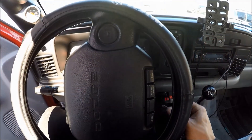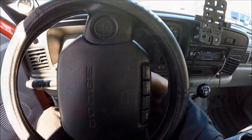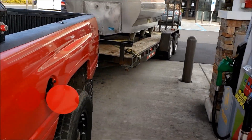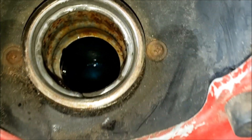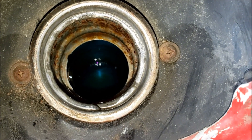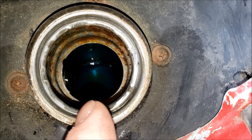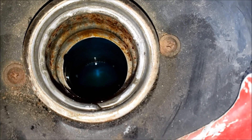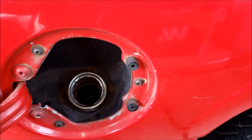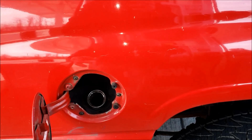And now for the big question: what fuel mileage is my Cummins going to get with the trailer and tank behind it? Just filled up at pump six at the Wawa here. The way I'm doing this is filling it to the tippy top until it clicks, letting the foam settle, topping it off again, letting the foam settle again, and then bringing the fuel all the way up so it's about six inches down the filler neck — so we know the foam isn't going to throw off our calculations, since diesel fuel likes to foam a bunch. Let's hit the road.